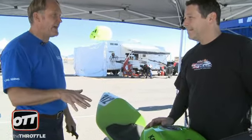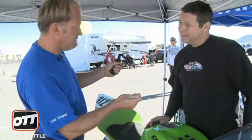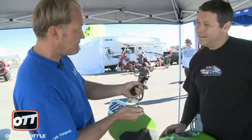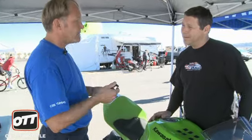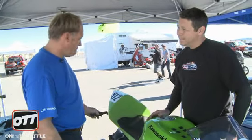If there's nothing there and it's fine, once you get further into the laps — because sprint races here, what, six or eight? Sprints, eight. Pay attention to the front end. If at eight laps it's all good, but at 12 laps it starts getting a little different, that's okay — who cares? We've got sprints and it works in the sprint race. Endurance racing is all about how does a bike change and how do I need to adapt, because the shock's getting hot, the forks are getting hot, the oil viscosity's changing because of the heat. But how does that work for your sprint race? A sprint race is technically nine laps — your warm-up lap where you're aggressive, braking hard and accelerating hard, straight up and down, and then you've got your eight sprint laps. So if the bike's consistent through ten laps, you're fine for tomorrow. All we've got to do is figure out the tire wear.